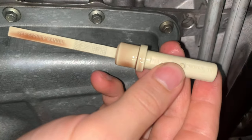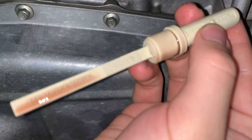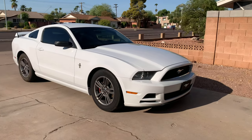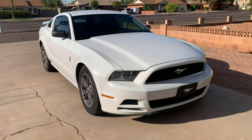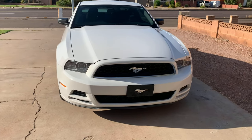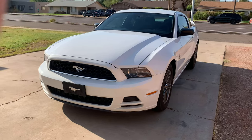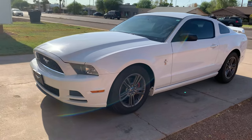As you can see, we're almost to that first little marking where it needs to be, so just going to put a little bit more in. I only had to add just a little bit more transmission fluid. The car's been driving great and shifting really great after doing that. Didn't have any issue before, but this definitely is just some maintenance that was needed. Car has 118,000 miles — I know Ford recommends 150 to change it, but as you can see it was definitely due for a change. Hope the video was helpful, guys. Thanks for watching.